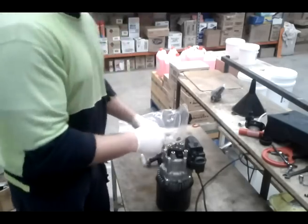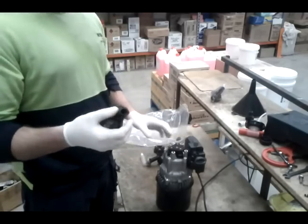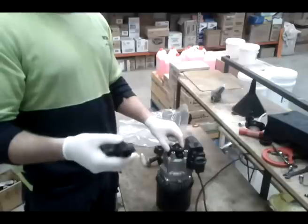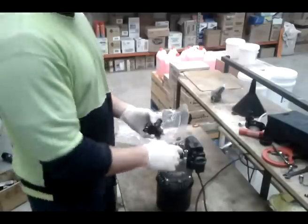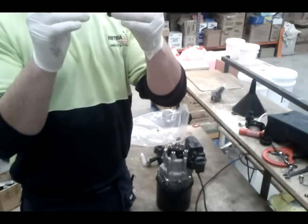Now, after replacing that and you put on the cylinder head and it's still pulsating, even though you've got power, that pulsating can cause some damage to the cylinder head, making it crack and do damage to the seals. So you want to fix the pulsating up pretty quick. And the pulsating is caused by a little leak from the seal, or most likely you've got a little microscopic crack in here that's leaking.